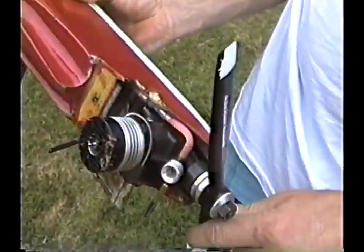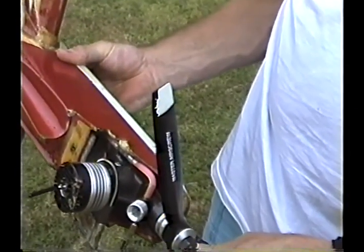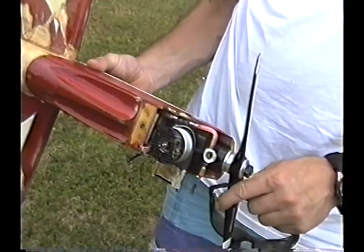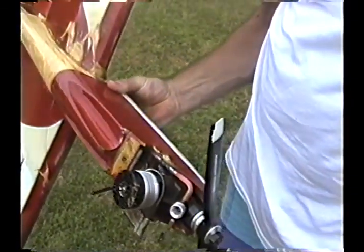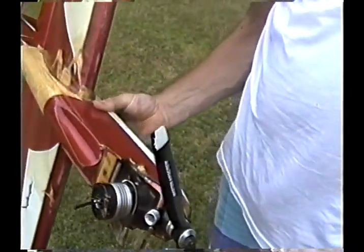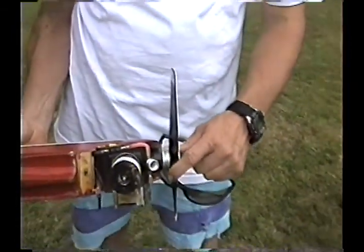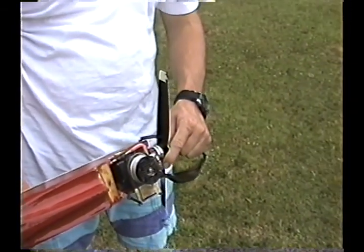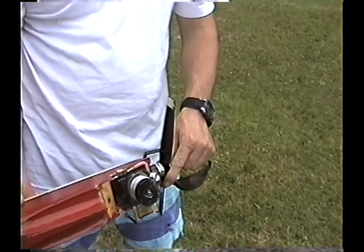Get some of the dirt off of there. How big is the Venturi on that? It's like 312 now. I opened it up, but it was still around 300. And Tommy Hampshire did his little heat ring deal on there, because it wasn't running. It would sit there and idle and die out inverted and stuff like that. And the only plug it would run on was a Fox plug. So Tommy did the head and mailed it back to me. Now it runs on pretty much anything I put in there.